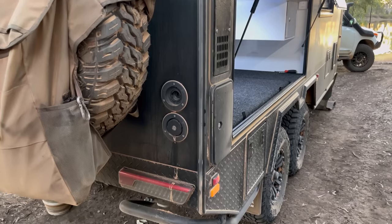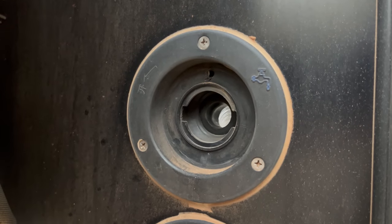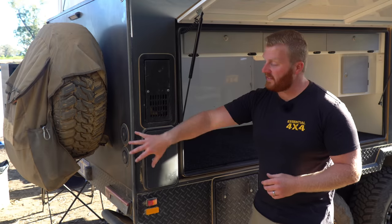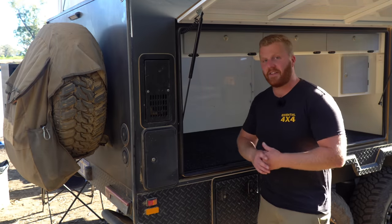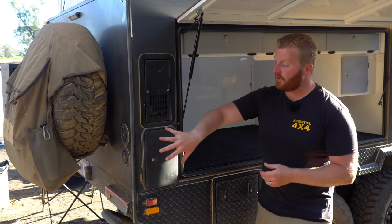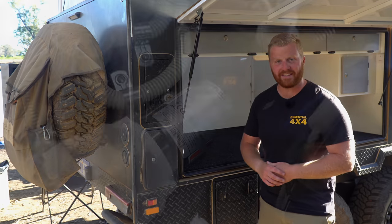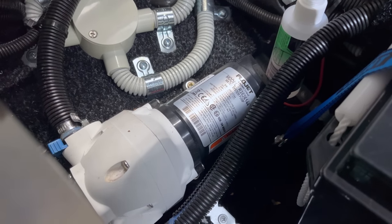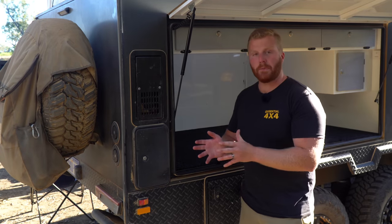The filler point on this tank is located at the rear of the van, and this houses a wide opening for the fill point and incorporates the vent for the breather tubes too. The fill points have only recently been moved to the rear panel of the camper — they used to be located on the side panel underneath the storage hatch, but there were a couple of issues with the gravity fill. Having them on the rear here lifts them up a little bit higher and allows the water to easily fill and remain within those tanks. The three tanks are drained together by a 12-volt Flowjet water pump located at the rear of this compartment, and these draw about 8 amps when in use.